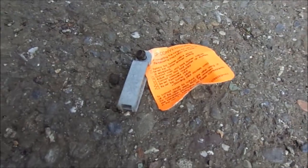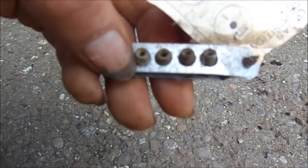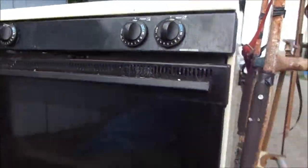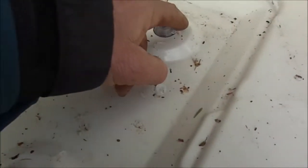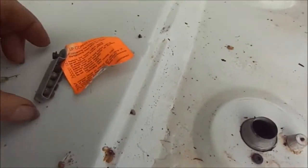These are the jets that go up on top and there are instructions here for installing them. Basically these jets will go in place of the ones already installed. To loosen the top we have to take these holding screws off — on this particular one there's only one holding screw. You can do this with a deep socket; this is a 9/32 socket.